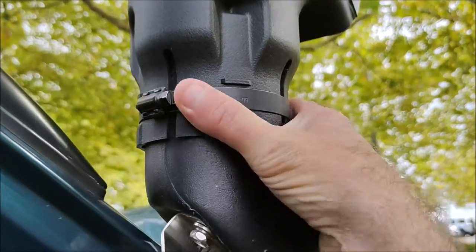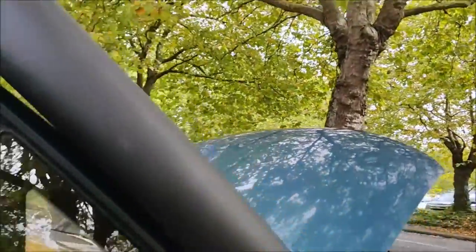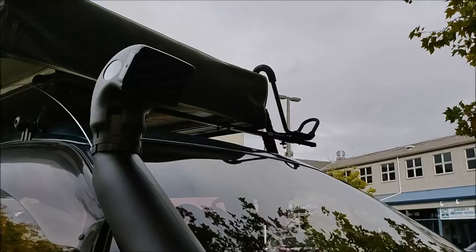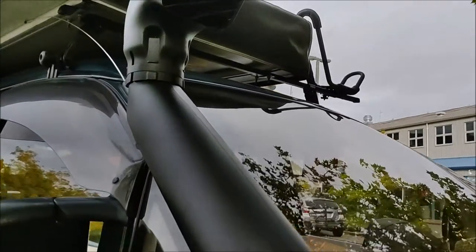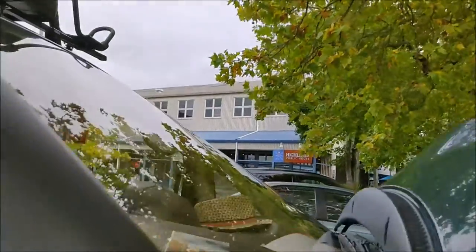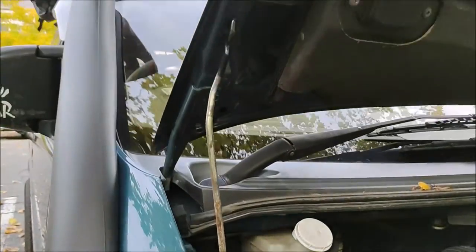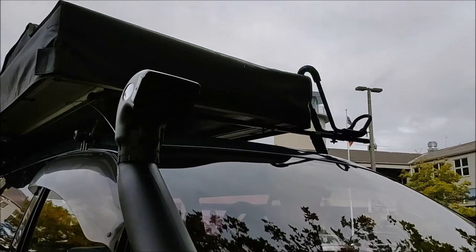And then I've got a washer with a little lock washer on there. Tightened it all up. This hose clamp here came with it. I've seen some people mount these snorkels backwards — well, maybe two people. I don't see the theory in that. I guess it's so driving water doesn't come in. The amount of water that's ever going to come in is minimal to me compared to the potential added benefit of having essentially a ram air system — where as you're driving, fresh air is getting forced down into the induction system. And I would almost feel that switching it around backwards might actually act as a vacuum, much as you would find on chimneys that get a draft going to suck smoke out. So I like it forward.